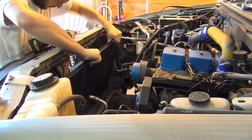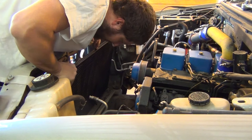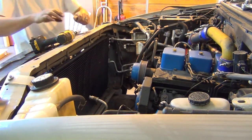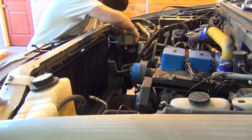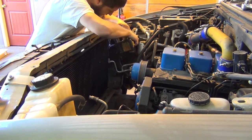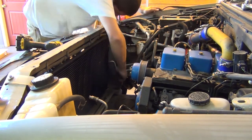It just goes down on those rubber boots at the bottom. They air-test these - did you hear the air come out of that? Interesting. They ship it with air - it comes pre-charged with a little bit of air to let you know it's working. If you're ordering a new condenser, make sure you don't just have two rubber plugs sitting in there holding compressed air.